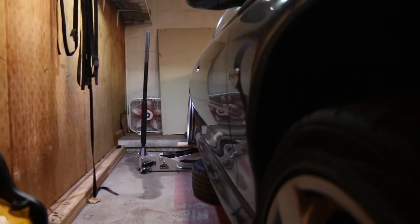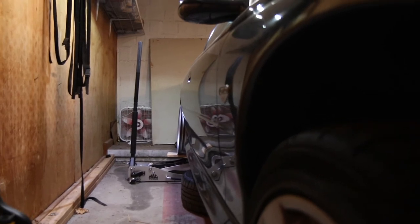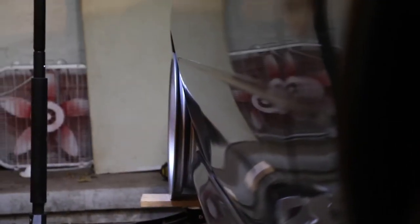Tried it on the front, give you a little taste on the back. First time I think I've ever gotten a fitment right. Shout out to Zach. Fitment is a little bit more poked. I do plan to run about one and a half, two degrees up front and about one degree in the back. But can we just give my fenders a nice roll, and everything should be really good.